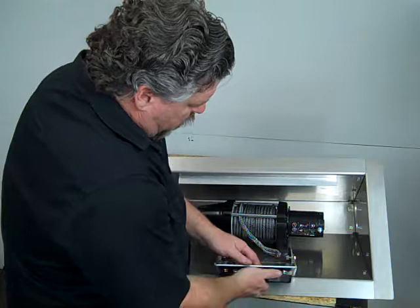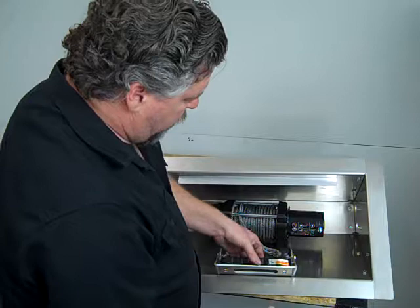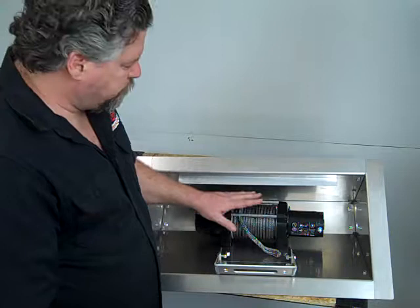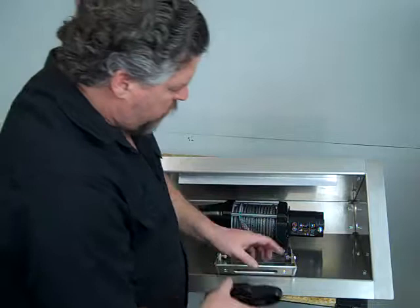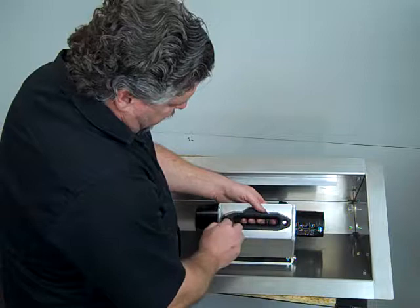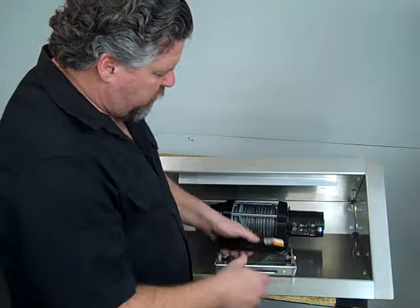So when this folds up, it'll be coming out flat and you'll be able to hook onto your car. It doesn't matter which way they go on — you can put it on the inside or the outside. If you go to put another winch in, they will fit ATV winches. Some of the smaller winches will have a smaller drum, so the fair lead will be a little bit narrower and you'd probably have to re-drill the holes, but it'll still fit because they're about an inch or so narrower — like some of the 2,500 pound winches.